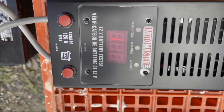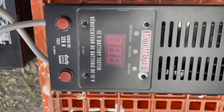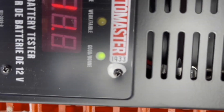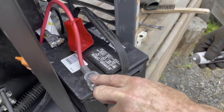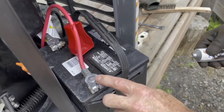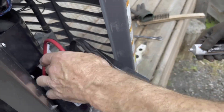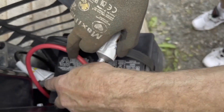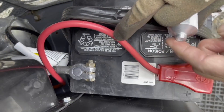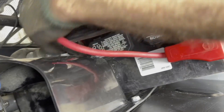One more thing we can do before installing the battery is to load test it. Unfortunately the camera doesn't pick up the LED display, but we did get a green light so we passed. Installation is the reversal of removal — connect the positive cable first, and put dielectric grease on the post. This keeps air and water from getting between the post and the clamp; apparently when that reacts with the acid, that's what creates the deposit. When pushing the battery into position, these cables are a little long, so make sure they're not rubbing up against anything sharp or jammed up against the regulator.